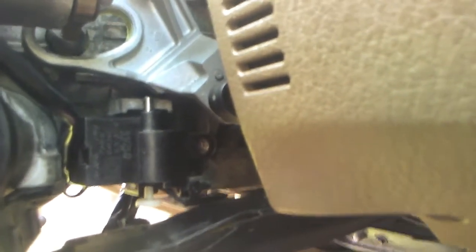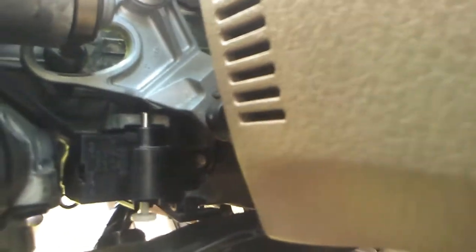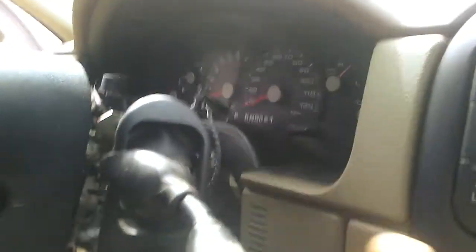Right now it's actually working because this is an intermittent issue. But if we pull out of park and go back into park, now our pin is up. Pushing on the brake doesn't do anything.